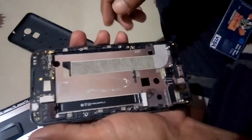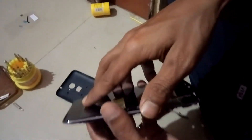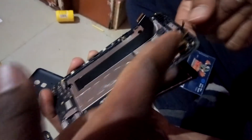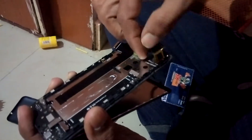Try to insert the new cable with the new display. Take the new display and place it from the front, making sure the cable is coming out from the back. There is also another cable from the front side that should also come out from the back. Remove the old display — you can see the old one here. Remove that old one even if it is broken or damaged, no matter what happened to it.